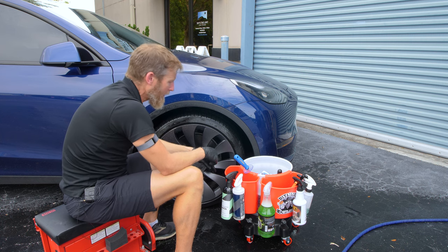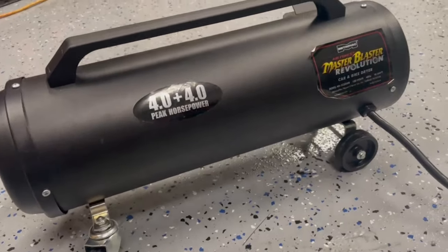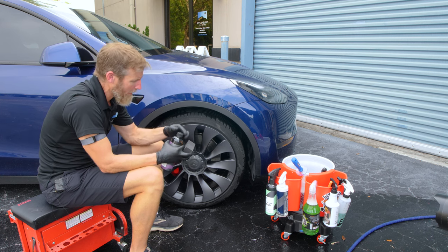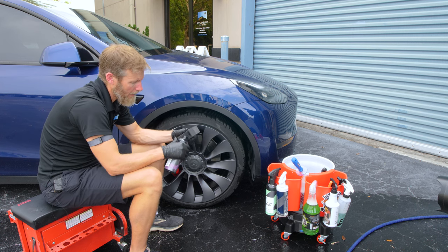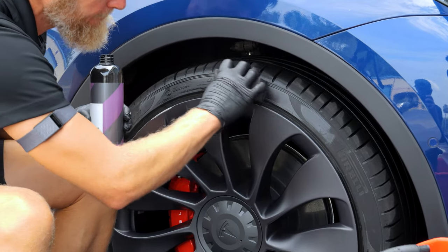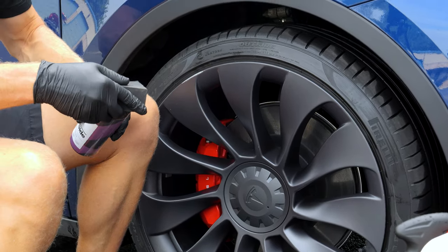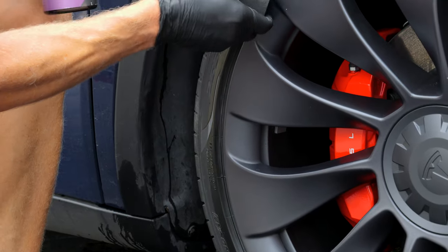Next step, we're going to go ahead and dry all this off. You could use an IncrediBrush with a drying cover and a towel, but we're going to use the Metro Master Blaster — it's far easier. For the final step, I want to protect the rubber. The Dark Side does come with a pump, but I like to just tilt the bottle and get a little on. Based on our testing, it should stay looking good even if you're driving through rain for about a month. After that it's going to start to diminish a little depending on your environment. One thing to be aware of after applying this to the tires is they do need some curing time — you want at least an hour or two before you drive in the rain.